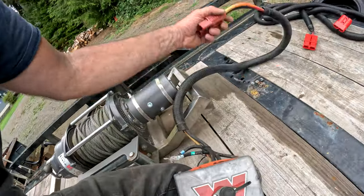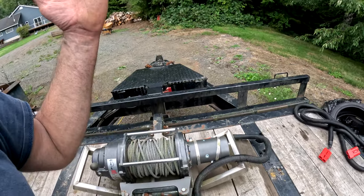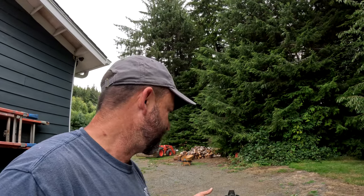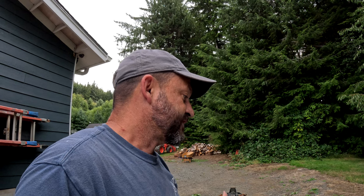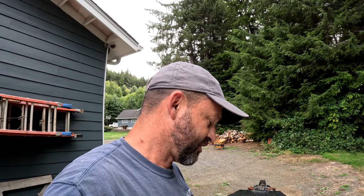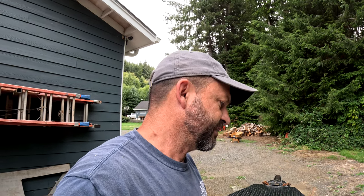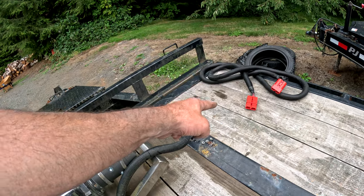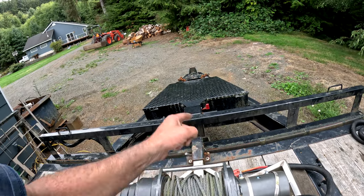I'm going to add one more little detail to this project. This solenoid pack right here has factory-length battery cables, and I've got this 200-amp power plug on it. The problem is these cables are too short when the deck is fully extended, and half the time I forget to disconnect the winch — when the deck goes up I'm stranding this cable and it pops off. So I've made up this extension cable, but half the time I forget to use it, and those connectors are kind of finicky. They're capable of passing a few hundred amps, but they get a little corroded. If I can eliminate one pair of them, that would be great. So I'm actually just going to put some ring terminals on the ends of this cable, hook them up to the solenoids in here, and that should be long enough to run right to my plug on the battery box up there.